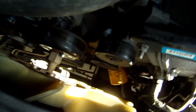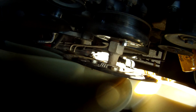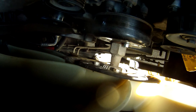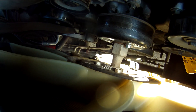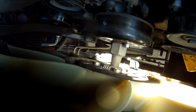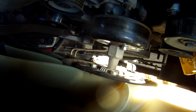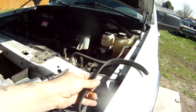However I've hit a snag, and that's — if you've done this before then you know that not every fan and fan clutch is easy to take off. Sometimes they get stuck on there. Sometimes I've had them take me as long as two days to get off. The conventional tools that we normally use to pull this one off are not working, and I actually broke one of my strap wrenches in an attempt to get it off.